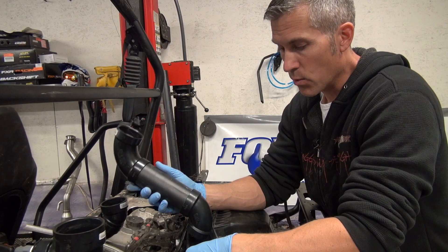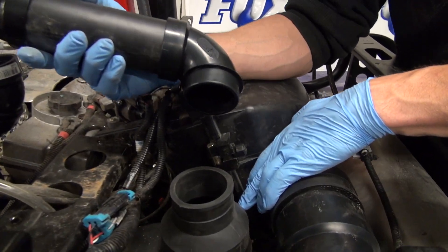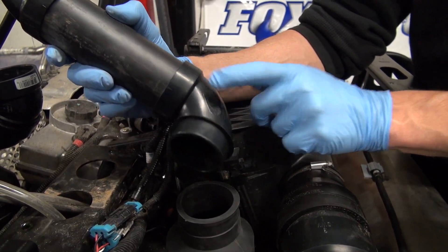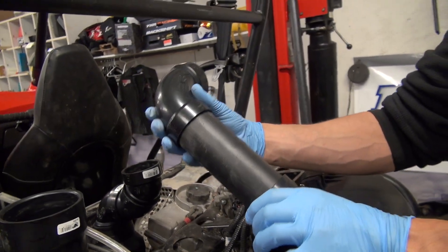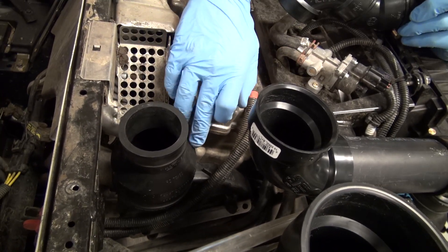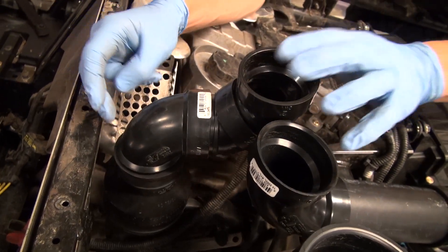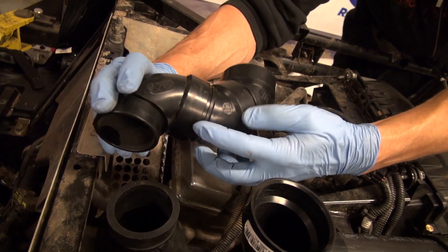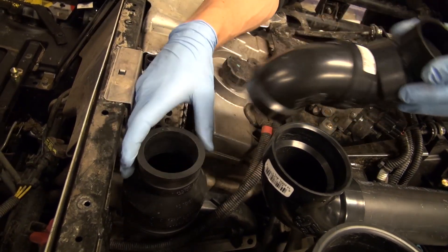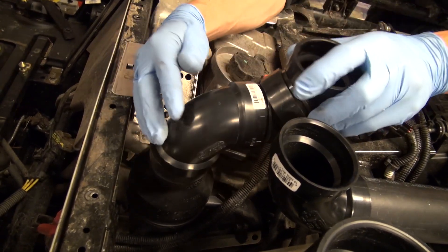Now this is the snorkel for the clutch housing. This is for the clutch housing exhaust, and that is a three-to-two-inch rubber adapter. That's a street 90 — female end, male end. Short piece of ABS and a 90-degree with female on both ends. And then we have the clutch housing intake, which is another three-to-two adapter with a street 90. Fits in just perfectly. And we've got two 45s here — they're both streets as well, so they have male and female ends. The good thing about these rubber couplings is you can offset them a little bit, mount them kitty-corner. When you tighten them up, they'll still seal. So they're a little malleable, which is good.